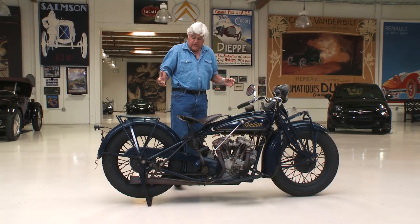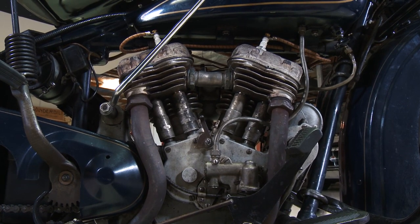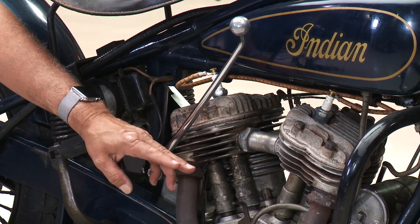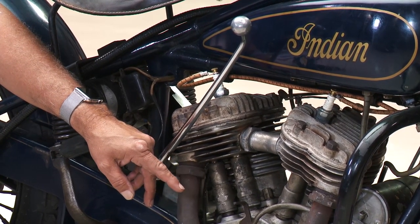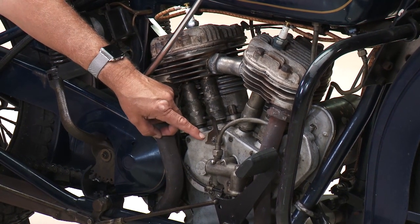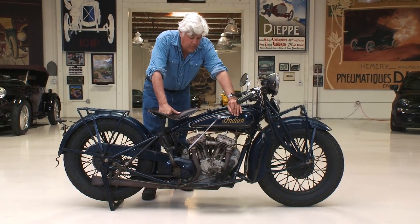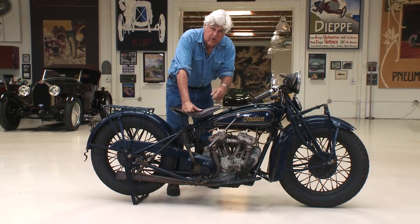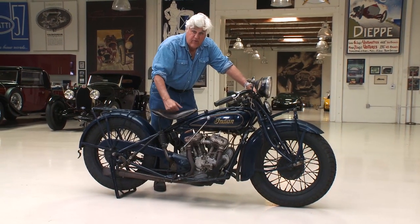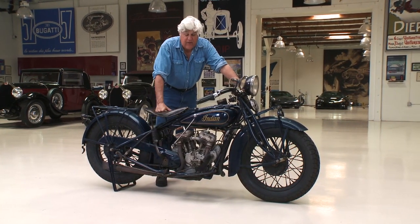It had all kinds of interesting features. It's 750cc. Two camshafts, one for each cylinder, and each camshaft had only one lobe — the cam doing double duty on both the intake and the exhaust valve on each cylinder. They had a bell crank valve that operated it. The front cylinder cam gear spun it. There were three gears in here and the third gear turning a magneto. Other motorcycles had a chain drive for the primary, which you had to adjust and would get out of alignment. These were all gear driven — more expensive engines to produce, certainly, and maybe a little noisier, but they lasted the life of the motorcycle.